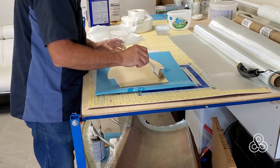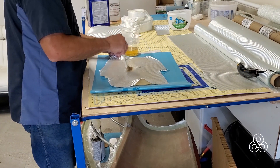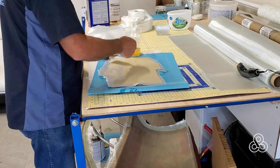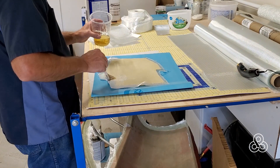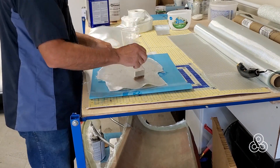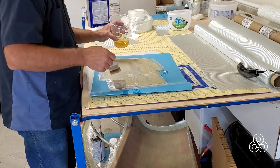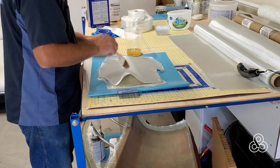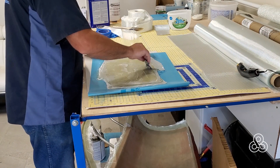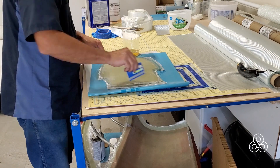In the other video when I did the expanding polyurethane foam, I mentioned you had to put micro balloon filled resin on top to create a smooth surface — that's because the cells on that expanding foam are really rather large. Compared to this commercially created foam split to an eighth-inch thick sheet, the cell size is pretty small, so a little resin fills them right up. I go ahead and saturate these layers, squeegeeing out and keeping the resin weight lean on top of the foam, but with a little more saturation in that overlap — that fiberglass hanging off the edge. We want it pretty soggy so that when we put it into place we have enough resin to press it onto the back side of the tub.